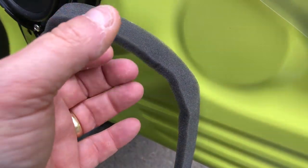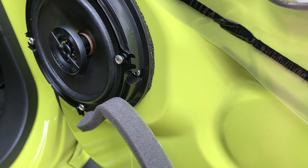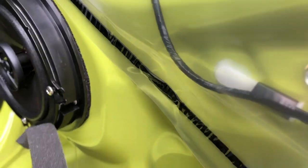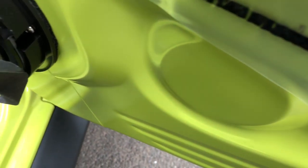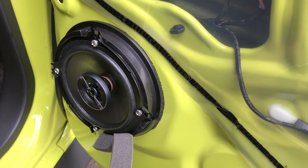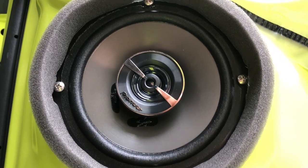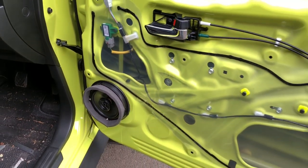The next job is to apply some of the thicker foam supplied in the kit around the edge of the speaker. What we're trying to do here is to direct the sound through the cone and make sure we don't get any leakage. The important thing is not to stick it to the speaker cone itself, but to use the lip going around the edge of the speaker. Stick it on there and pull it all the way around so that it forms a conical shape when we fit the door panel back on — that conical shape of foam to direct sound through the door panel. Check that it works before we refit the door panel.